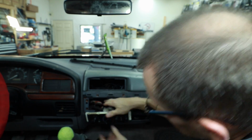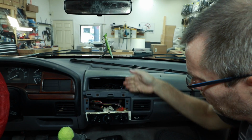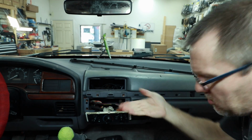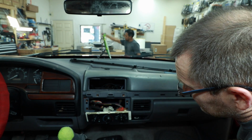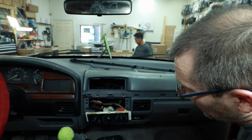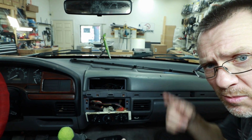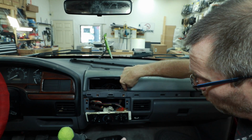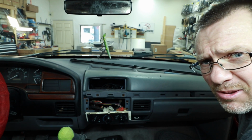and that'll be enough room so that we can get in there and do our cutting. So we have a lot of options as far as saws go. Normally we use like a buzz cut, panel, straight blade, one of those little flush cutters, but because we have to do multiple angles here, I think the air saw is probably going to be our best option to get all these little compound angles. I wouldn't use a roto zip only because it spins and you don't want it to walk into this dash pad even though you are going to be covering it. I don't like doing that.